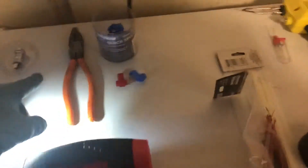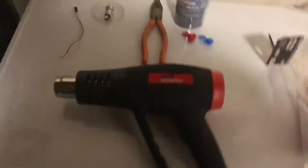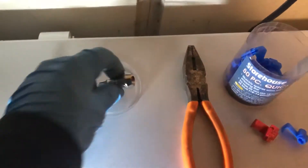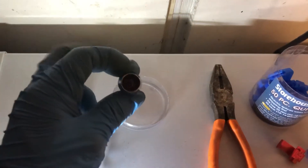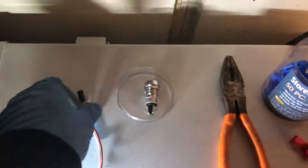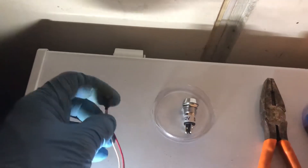You're also gonna need a heat gun, and I use these quick splices to splice the wiring. I'm not gonna lie — it's not hard but it's real tedious. I'm gonna use this indicator light to let me know when the system is actually on, when it's actually pushing methanol in. And this is going to go to my low level switch on the methanol tank.